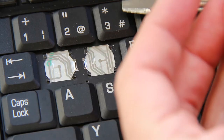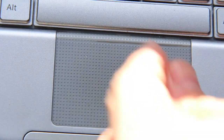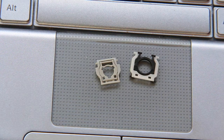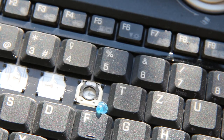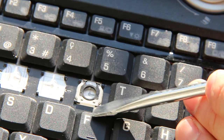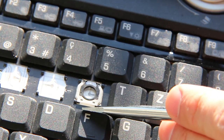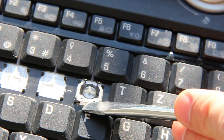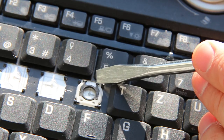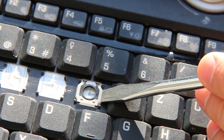I'm going back to the computer I want to fix with the parts side by side — the good one compared to the one we know is bad. What this video was going to be about was fixing keys that fall off, but what I found is that different keyboards aren't exactly the same in terms of these mechanism specifications. I have a Toshiba and a Sony — they have the same basic design but the mounts are a little bit further apart on one, so they're not interchangeable. I thought they'd all be the same, but they're not.